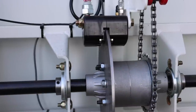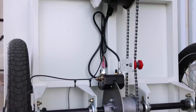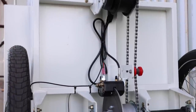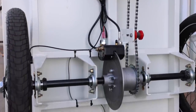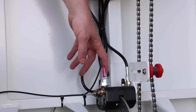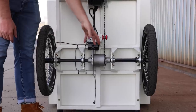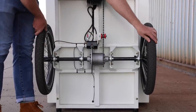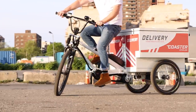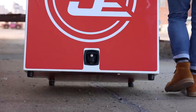You can see the brake here — it's actually a motorcycle brake made by a company called Wilwood, also a U.S. company. Really the first e-bike I've seen with a motorcycle brake on it. You've got the drivetrain running into the rear axles. Look at this disc rotor and the heavy-duty pads. You can see wires coming out here — this is actually where the rear brake light is actuated. They're running the sensor directly from the brake caliper, which is pretty interesting, and certainly the first time I've seen that. There's also a differential here which allows the wheels to spin independently — really important when you're going on a turn, as the outside and inside wheels spin at different rates.